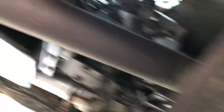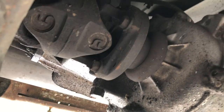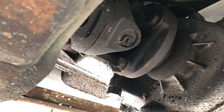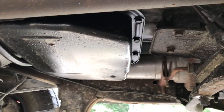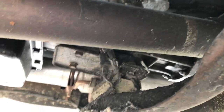We need to take off both front and rear drive shafts. You can take off the transfer case if you want — I'm going to try to leave it on and leave it attached this time, because taking it out with all that extra weight makes it harder to put back in. You have to brace up the back of the trans so you can pull out the cross member.